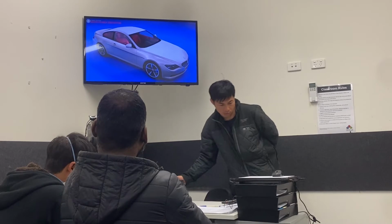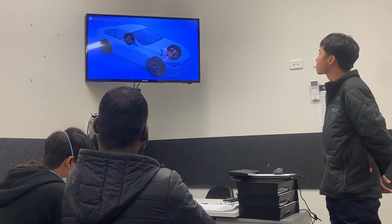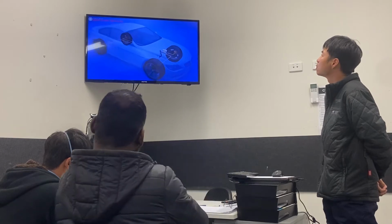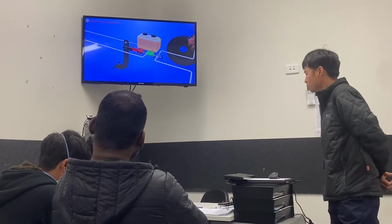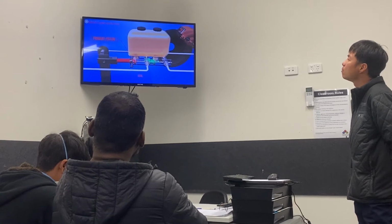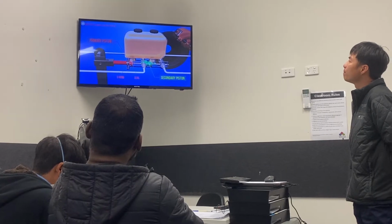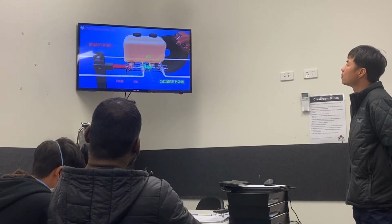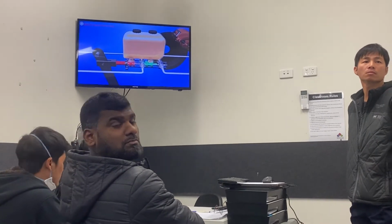Since the mid-1960s, federal laws require that all cars must operate a dual brake system. So if one system fails, the other would provide enough force to safely stop the vehicle. To achieve this, the tandem master cylinder was introduced with two separate pistons, each applying hydraulic pressure to two wheels. The primary piston assembly has a seal located in a machine groove at the front and a secondary cup or O-ring at the rear. The secondary piston has two primary seals located in grooves, one facing forward and one facing rear. Return springs are used to push the pistons back to their rest position when the brake pedal is released.